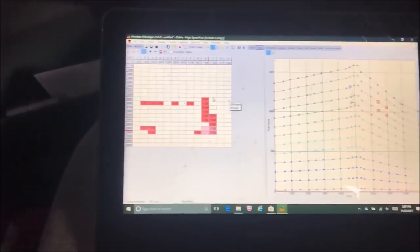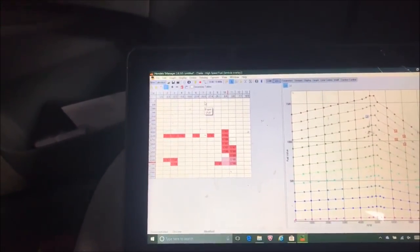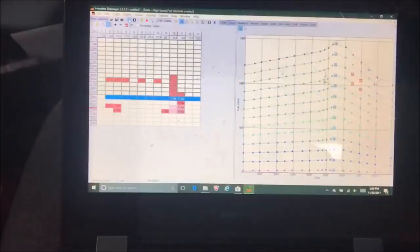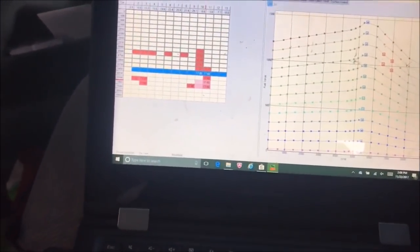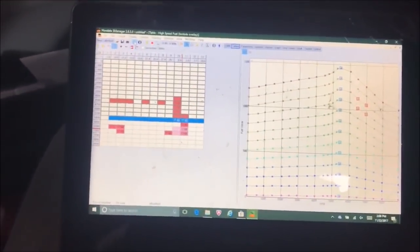So in here, you can see where my graph is — you can see where I went. We know from here down we need to pull some fuel. You can see the changes I've made: I've got less of a curve here, I'm still pulling fuel away as we go — similar to what the torque curve would do, so that's what it's going to look like.